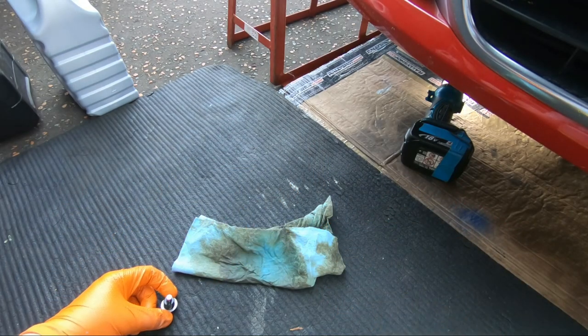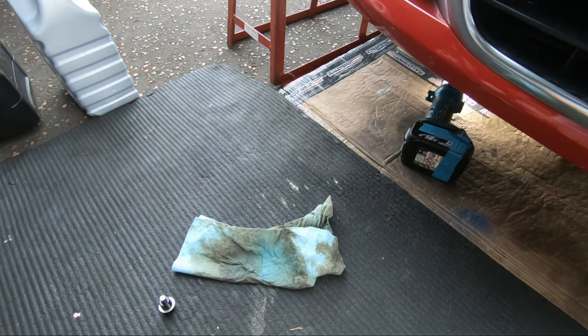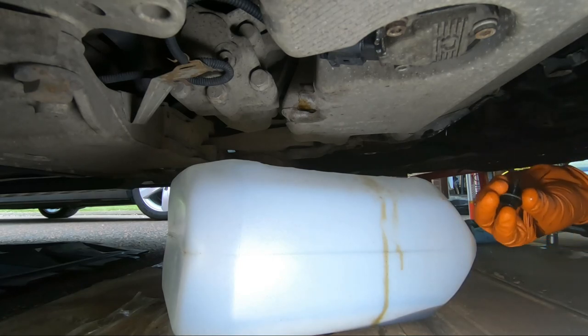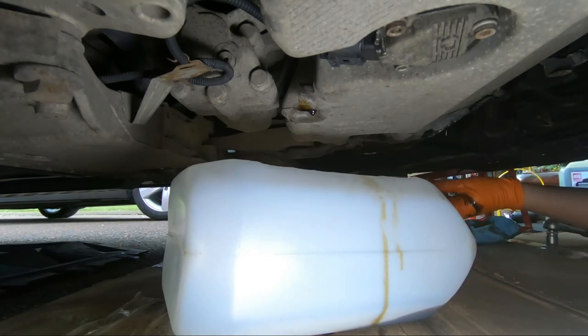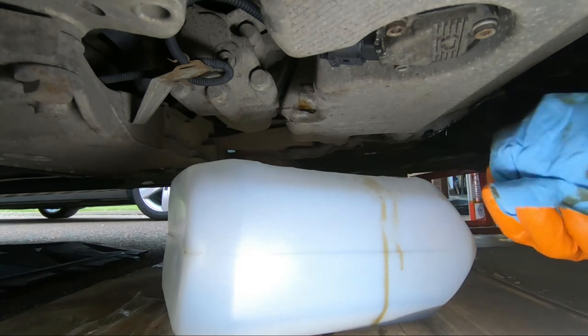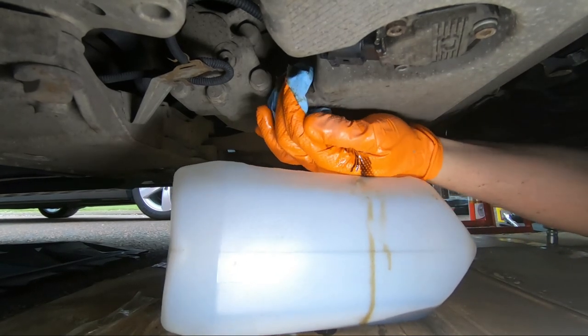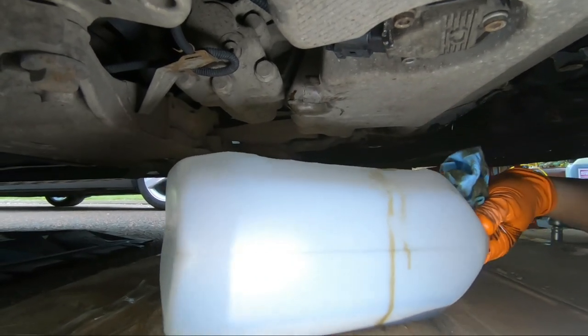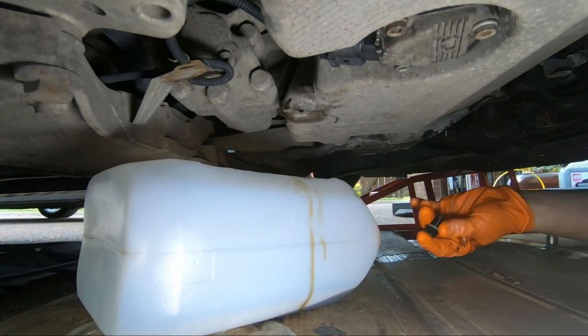We can now move on to having a look at the sump plug and whether we're ready to put it in or not, whether it's stopped dripping. So we'll go back onto the car. Okay, you can see there's very little coming out of the sump now, so time just to give this a wee wipe down and get the sump plug and new washer ready to install. So that's been wiped down. Get the sump plug.